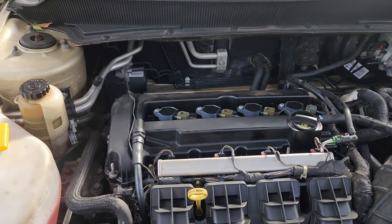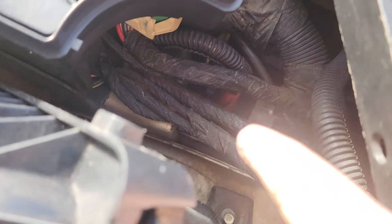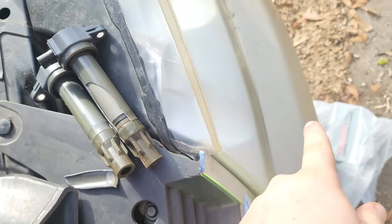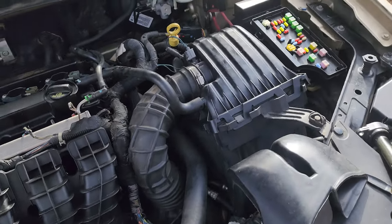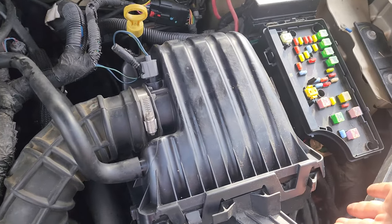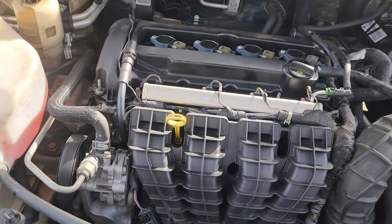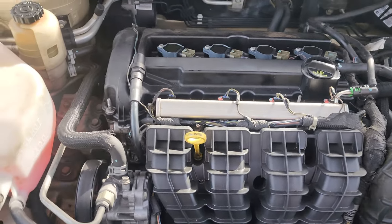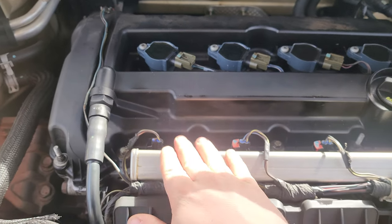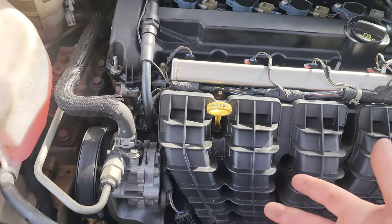Check your grounds. Dodge — I don't know if you can see the battery down in there, but there's a cable that goes to the battery. They thought it was a good idea to put it behind the fender. I put new terminals on it, charged the battery up, made sure I had good grounds on everything. It was still misfiring. So we started messing with injectors, checked the fuel rail, pulled it off, put a new oil sensor on there too.